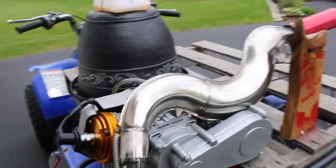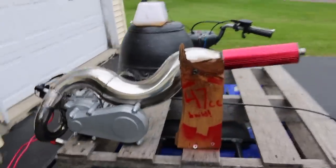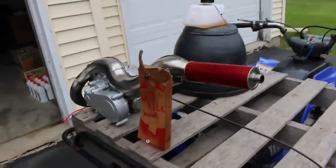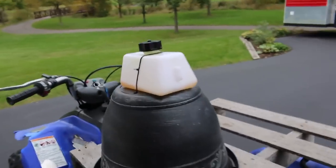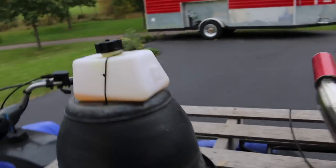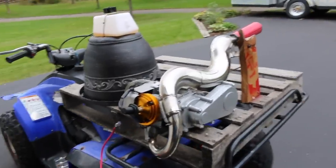With this engine we did the first start-up video a while back now, but I'm actually still in the break-in stages. I only ever run it when I'm doing videos with you guys — I should definitely run it off-camera a little bit more so I can get out of this break-in stage. When I first break in the engine, I like to run a 25 to 1 mix. I only bought a gallon of it, so I'm going to go ahead and use that up, and that'll be good for me as far as the break-in goes.